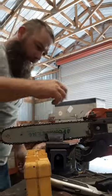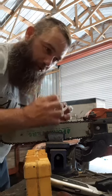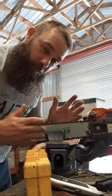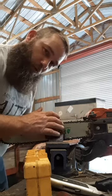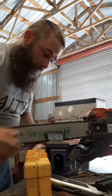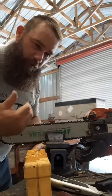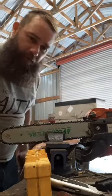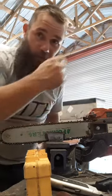Okay, but back to what I was saying. Let me set you back down here. On a semi-chisel chain, like I said, it's something that you don't want to teach on a square ground, or full chisel, or a lot of those different chains. On a full chisel, square ground, round ground, you focus on the worker corner and the top plate. But a semi chisel is going to stay sharper a little bit longer in dirt, a little dirtier wood, like if you skidded some logs and knocked the dirt off. But it's kind of deceiving how you know if it's sharp or not. And the way you know is like we just showed.